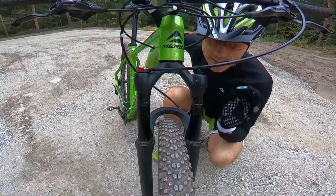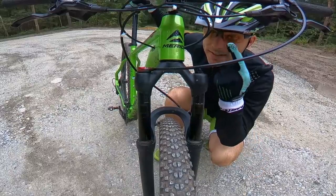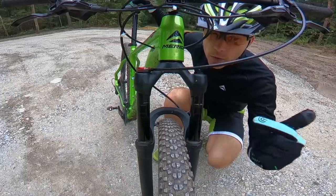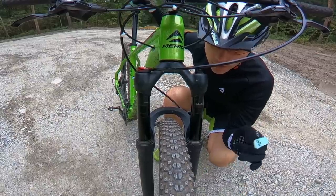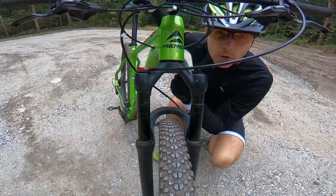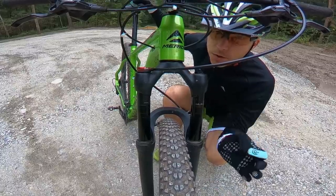The lateral stiffness: it is very good. It's actually easier for me to twist the stem on the steerer than to show you the fork twisting — it's more the wheel flexing than the fork. It is just stiff enough. And remember, this is the quick-release version — you can also buy the through-axle version. This is the tapered head tube version; you can also buy the 1-1/8 inch straight version if you need it.